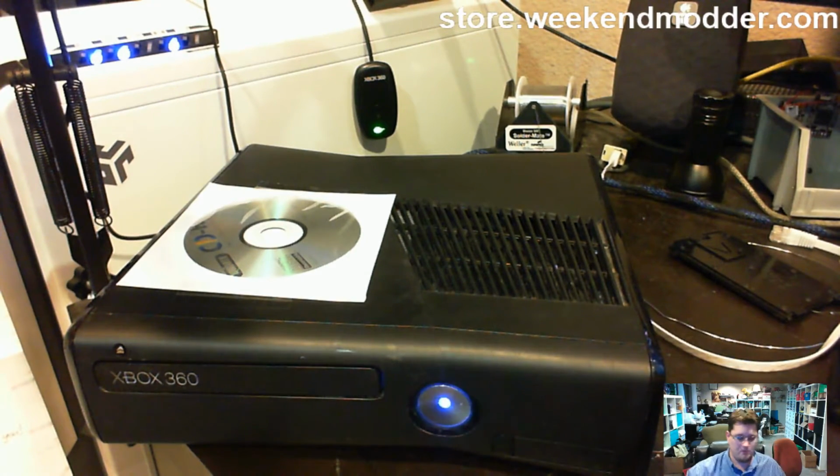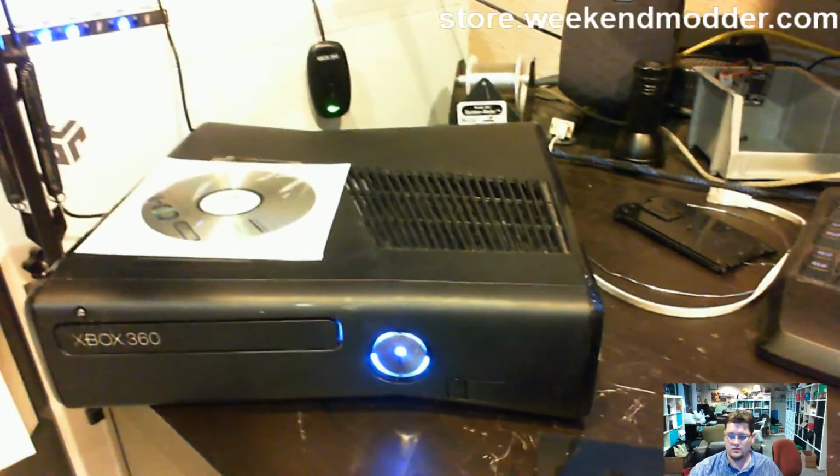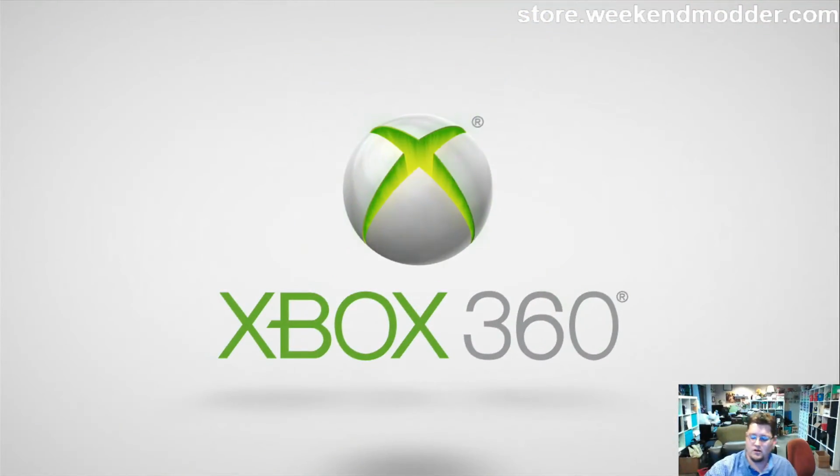We powered it up. You saw Freestyle. I'll go back in the recording to convince myself, but you saw Freestyle. And then the second boot, with no changes to the console, we E68'd. So now the third boot, after reseating the console, we E68'd. So now we've got the hard drive out. So this will be your proof that it is in fact the hard drive causing that.